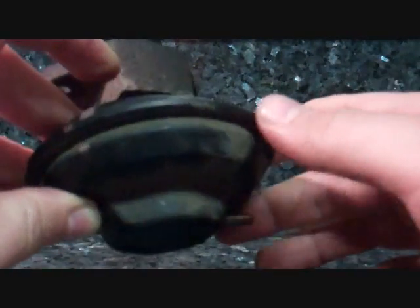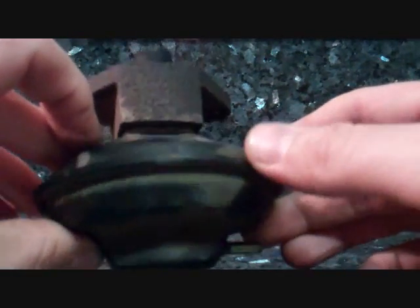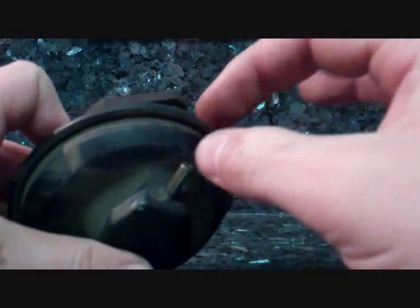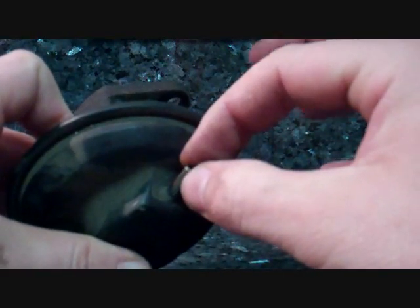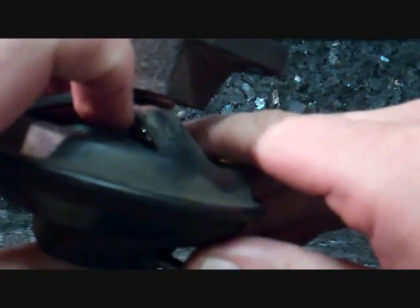So here's what I did — you can think of this as an alternate way to test for a vacuum leak on the EGR valve. Suction right here, when a vacuum is applied, will push down the valve like that. Now you hold your thumb over it — notice this one pops right back.